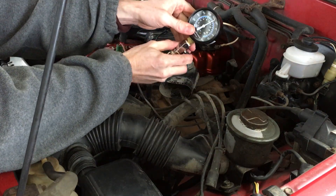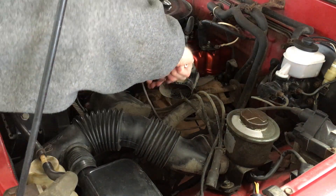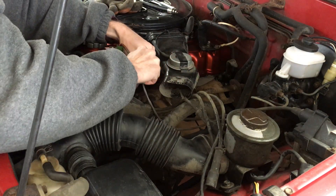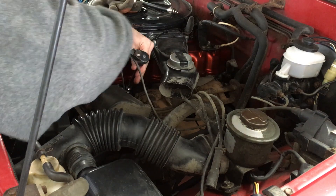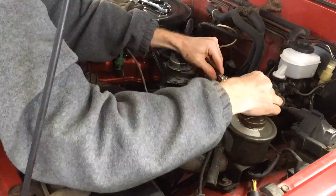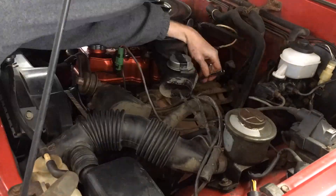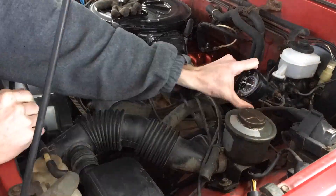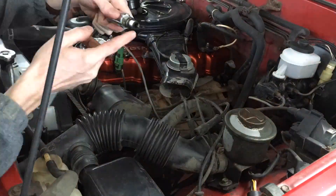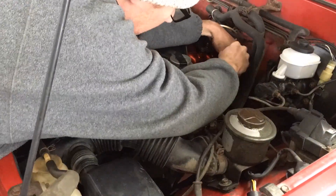Time to release the pressure, disconnect the gauge, and unscrew the hose from the cylinder head. I'm putting the spark plug back onto cylinder number 1 and moving on to test cylinder number 2. Note: this is an older carbureted engine where everything is mechanical. On a newer fuel injected engine, you'll want to unplug the distributor and the injectors to prevent the ECU from sending spark and fuel to the cylinders. On some models, you can unplug the ECU to prevent spark and fuel, but still allow the engine to crank.